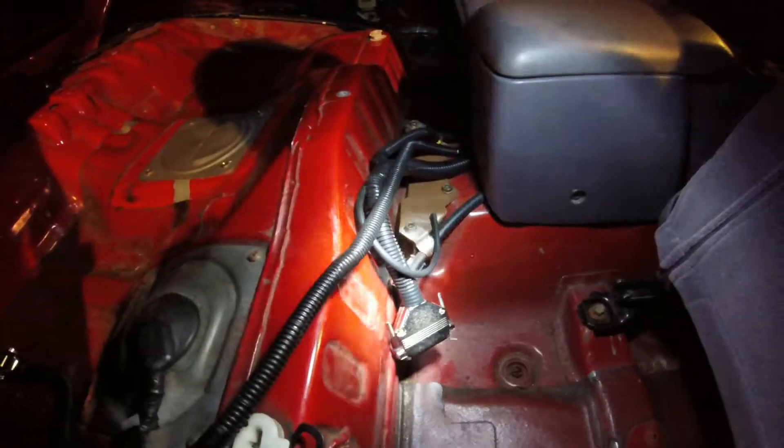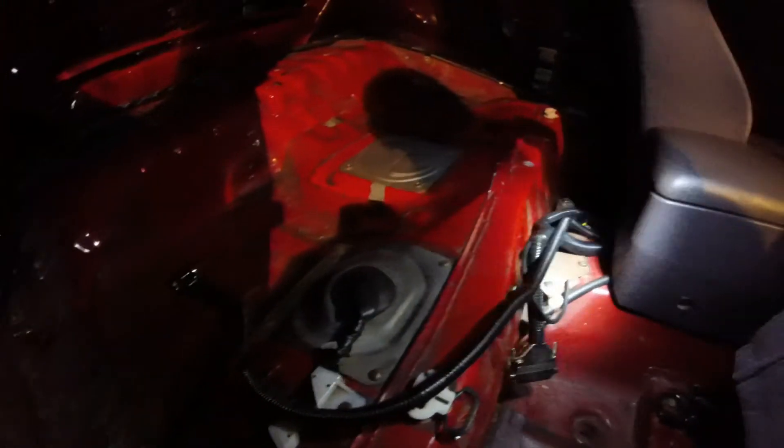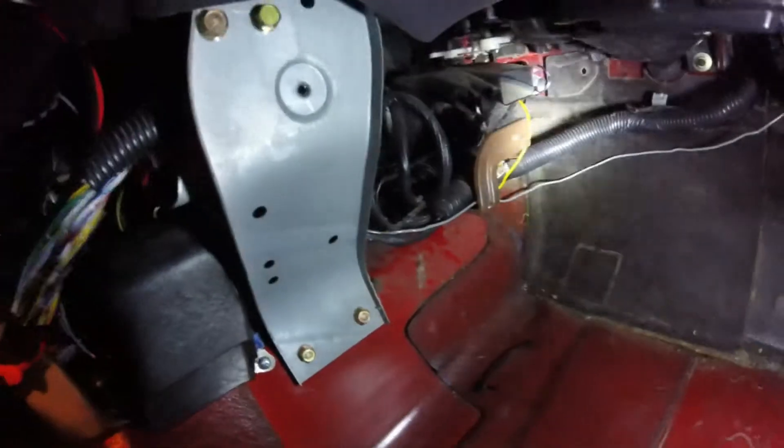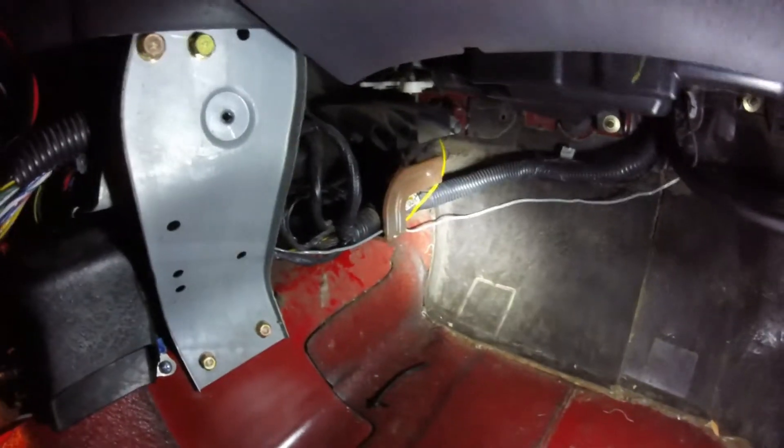The plug got all put back together and taped up, and this is the DB15 which has the one wire for my other coil drive. The wires run underneath the center console - kind of tight but it fits just fine. It runs up through where the stock harness is, along the back of my shifter - a decent spot where it can't hit anything. I used an old mounting tie that used to be for a stock amplifier, and it runs all the way up through the hole where the shifter cables are. It cleans this whole area up a lot - looks like it's meant to be, a lot cleaner and safer, less likely to get stepped on or yanked.